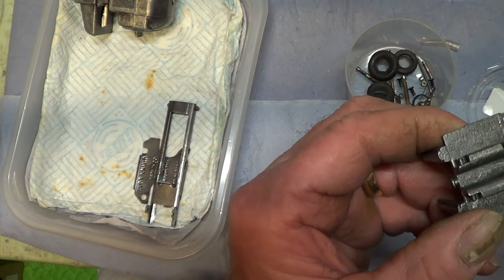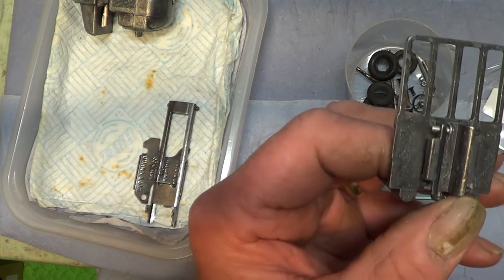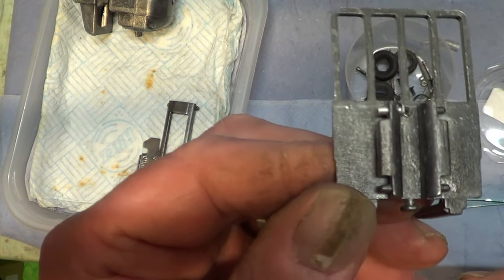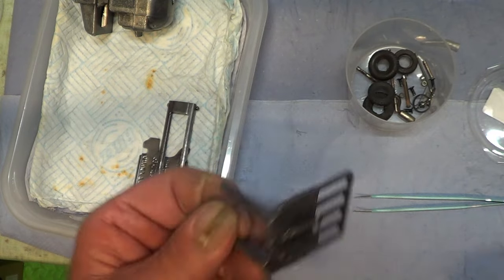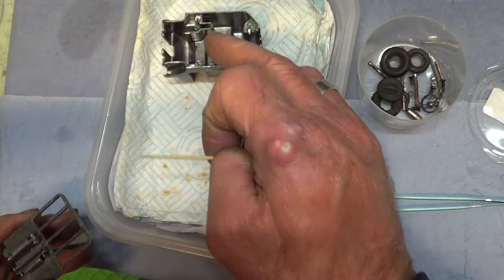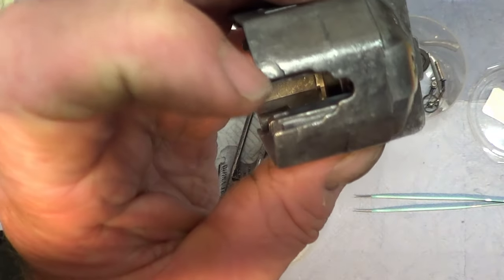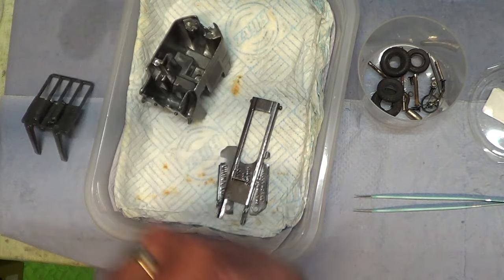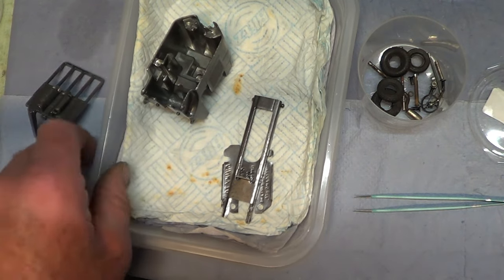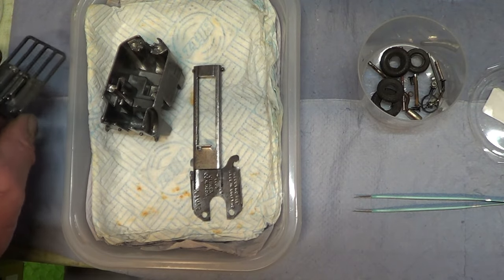And I'm hoping that'll do the trick. There. Right, oopsie, so I'm going to leave that bit to one side. I might go out and paint the rest because it's all ready. I've cleaned that with methylated spirits. I've got to do a little bit of body work on that because it's got a split there where I tried to straighten it. I'll sort that out, and then I'll go out and put the primer on once it's all sorted, and then I'll come back to you after that.